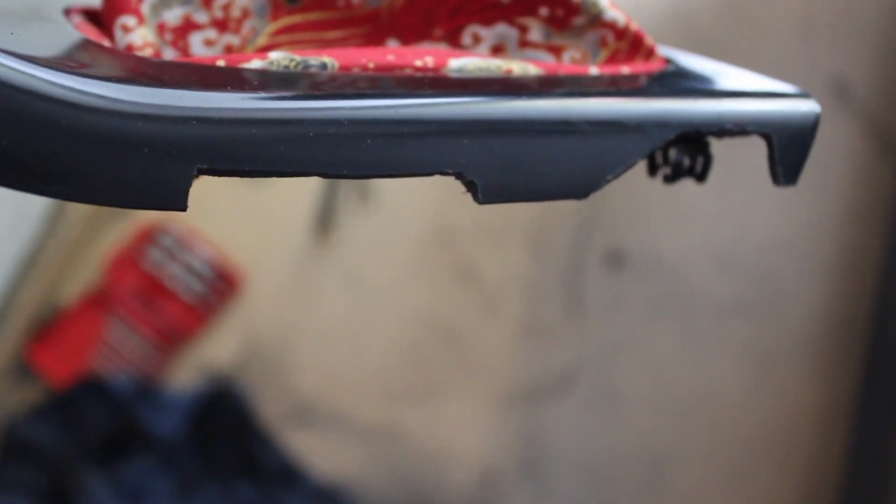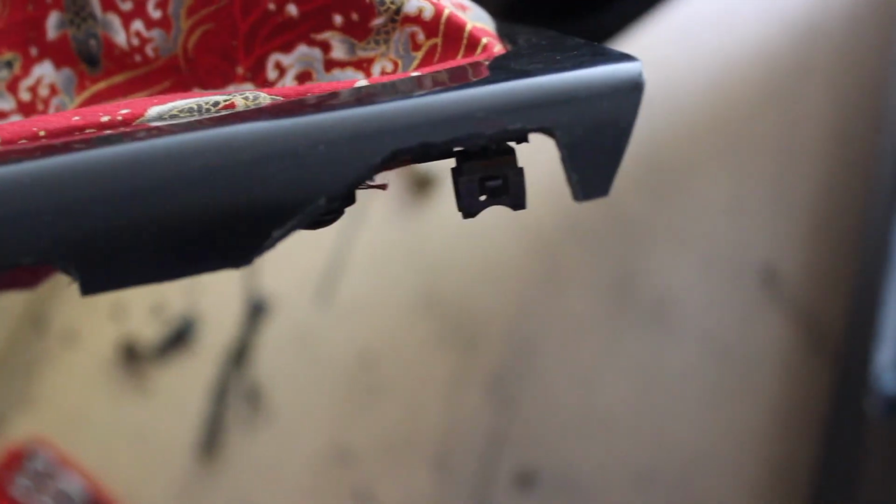This portion right here that I had to make bigger is because there's a nut on the hydro e-brake that connects the lever to the master cylinder, so that nut articulates, and what happens is every time you yank it back, the nut will move back on the master cylinder. So I had to make the clearance so that it could mimic the track of that nut when you pull back on the lever.